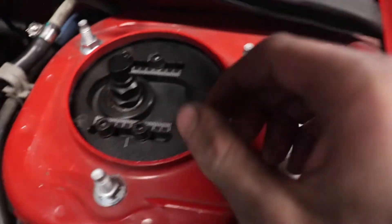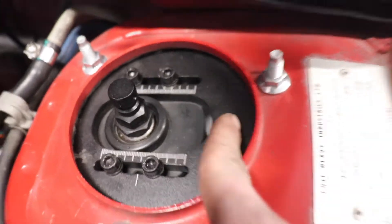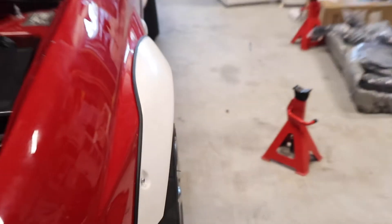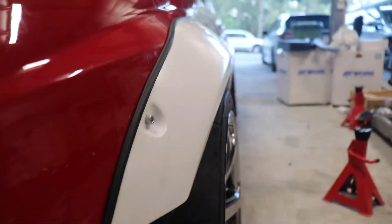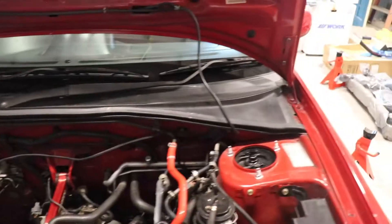You can see on the top here we have quite a bit of adjustability from the camber — that's max camber in, that's max camber out kind of thing. If you look close, you can see that's where the old camber setting was and that's where the new camber setting is. It looks a little bit better in terms of fitment lining up. Drop it down and see how it looks. That's much better — practically perfect. Did the other side as well. Spot on, really good on the top there. I'll just tighten them up with the allen key and then we'll move to the rear.